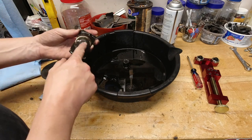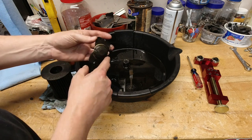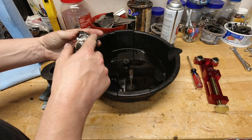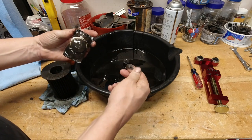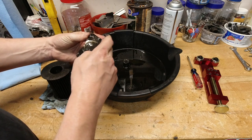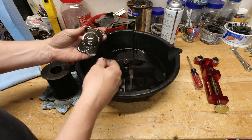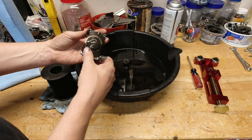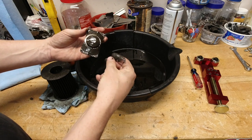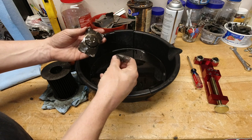I'm going to leave a link to another video by a channel called Piston Twisted Garage. Those folks have a different, more common way of doing this — using a paint or coffee filter to catch any chunky material coming out of your oil filter. Definitely go check that video out; it'll give you a different approach to this inspection.